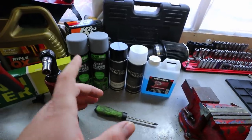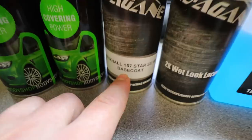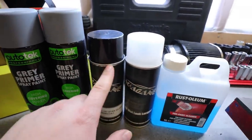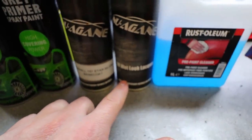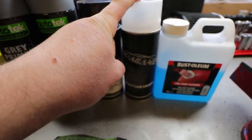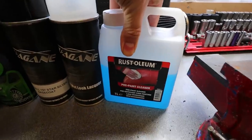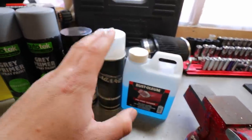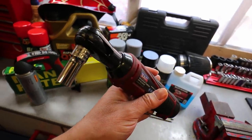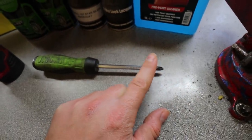Just before I go to the car and remove the spoiler, I want to show you the products we're going to be using today. I've got two tins of grey primer, I've got the Vauxhall 157 — which is the paint code — the Star Silver base coat. It came with a tin of 2K wet look lacquer, which should do a really good job of protecting the paint and give it a wet look. I've also got some paint prep — an alcohol-based pre-paint cleaner — and the tools to remove the spoiler: a 10mm socket on my ratchet, and a screwdriver for one Phillips screw.